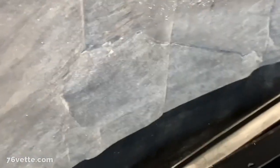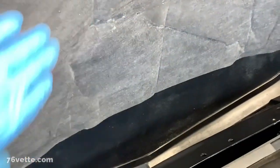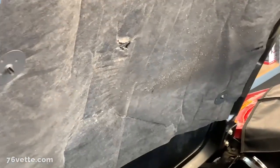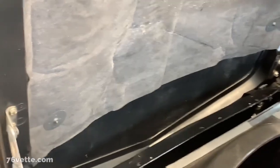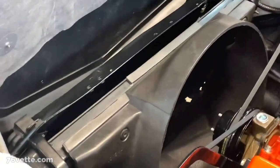And I don't know if you can tell here, you can see a little bit of an outline. And that's the hood, can't think of the word now. You know what I'm talking about. This protective pad. You can see the outline of the snorkel. So that is actually sealing properly above the snorkel, and again, for air to go into the snorkel, into the carb, and most of that ram air to go through the radiator. So yeah, that's looking really, really good. Next update when I get the seals.